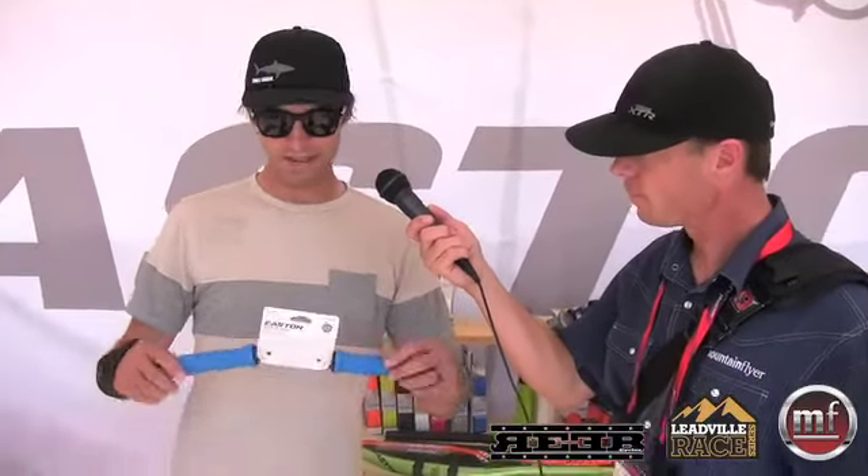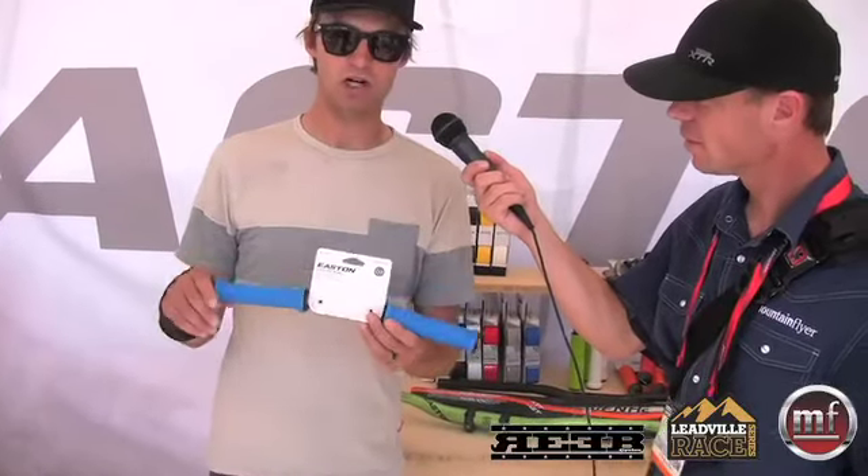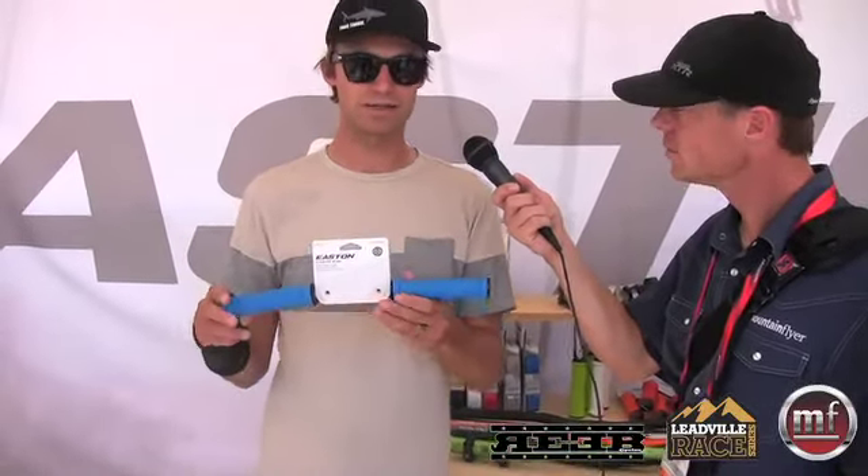Easton is a handlebar manufacturer — we're known for handlebars, especially carbon. But one thing we've noticed in the last few years is customers calling about torque specs for their lock-on grips on carbon bars, because you can damage a carbon bar by over-tightening lock-on grips. We don't get a lot of broken bars, but we do get some that are gouged up with real damage. So we designed a carbon-friendly grip. The clamp clamps onto a plastic sleeve inside the grip — that sleeve is what contacts the handlebar. The aluminum clamp doesn't actually contact the carbon bar, so there's no risk of over-tightening.